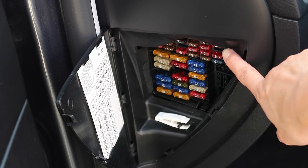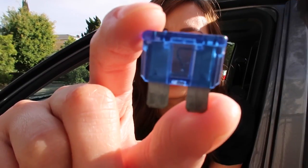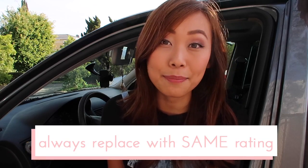You'll also see that there are a bunch of different sizes and numbers — what do these mean? Well, first of all, what we're looking at here is called a blade fuse. These are found in most cars. They come in different sizes: micro, mini, regular, maxi, and all sorts of colors. As you'll see here, there are two connectors and a circuit in the middle that connects the two. The number printed on the fuse is its rating — that is, the max current it can conduct, measured in amps. So you'll see numbers like 5, 10, 15, 20, 30, etc. It's important to replace the blown fuse with a fuse of the same rating. You could get an assorted box of fuses like this for less than four dollars at your local auto shop.